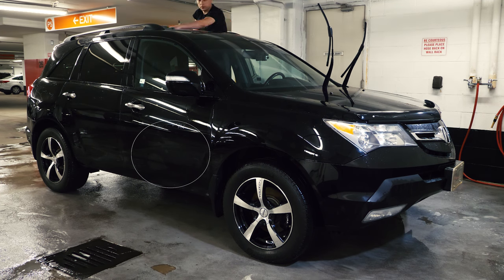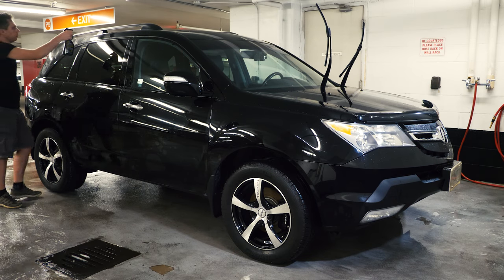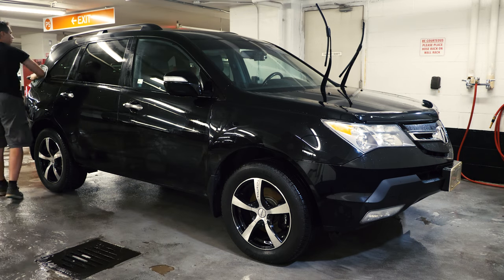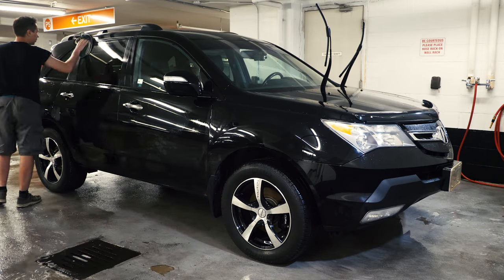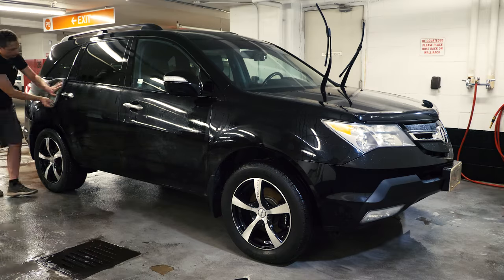It's no surprise, as the last time my car was decontaminated and went through the paint correction and polishing process was 4 years ago — so that is long gone. Topic for another video. Once you rinse the car, don't let it sit and dry itself, as you will get water spots because of the salts and elements in the water, unless you're using effective water filtration which basically turns your water into salt-free — which is not cheap.